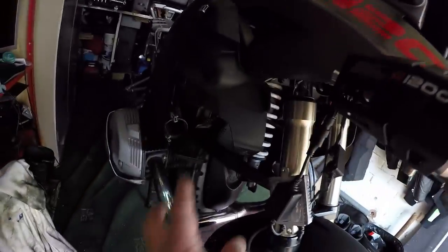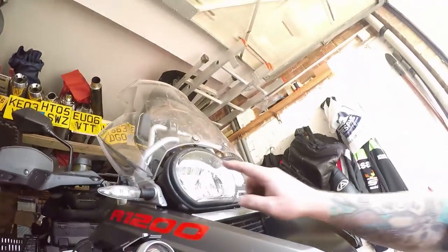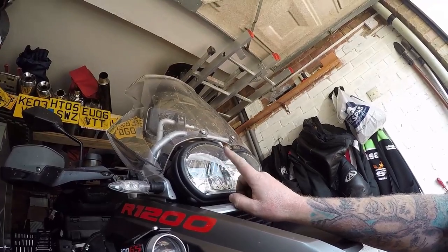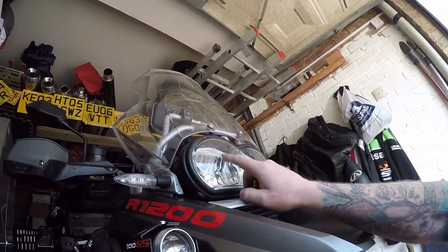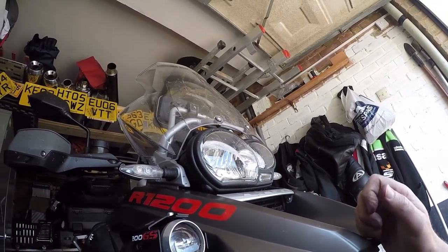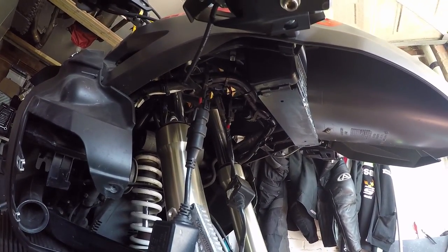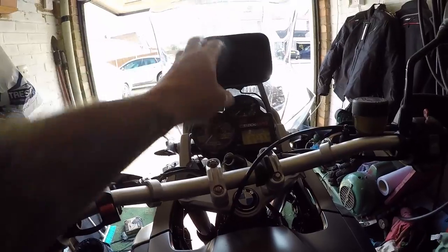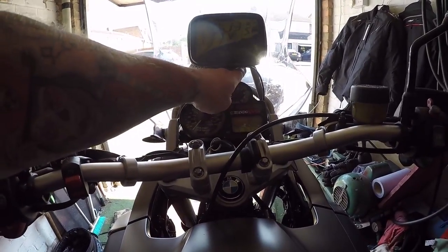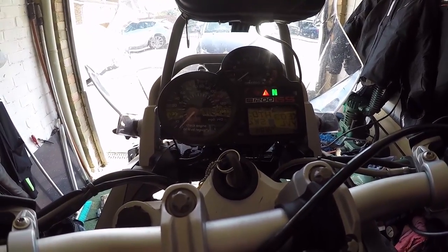I put these two on first. You had to put the bolts back in — I took the side off here, it's only a few bolts. I'm going to store this under here. Top tip: yellow is power, brown is earth. You can take the bulb off — think red and black but you've got brown and yellow. So remember, yellow is power. I'm going to stick this sort of under here, keeping away from the main bit.